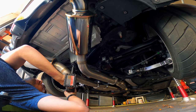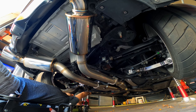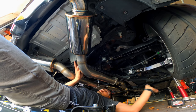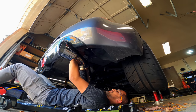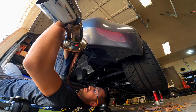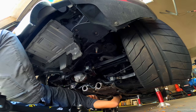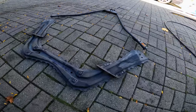I'm showing worst-case scenario to allow the subframe to be lowered enough to slide the inserts between the subframe and body without actually dropping it. All the chassis bracing needs to come off. The rear V-shaped brace has six bolts — two at the rear, two on the driver side, two on the passenger side — all 14 millimeter heads. I also discovered that with my axle-back exhaust still installed, there wasn't enough space to remove the brace, so the rear section of exhaust had to come out first. With it removed, there's ample space to drop and remove the V brace. There's also an additional W-shaped brace toward the front that has to come off, also held by 14 mil bolts. I cleaned them up and sprayed them with fluid film to prevent rust before reinstalling.